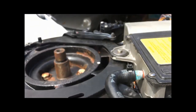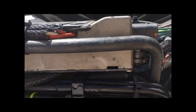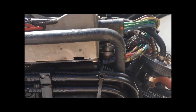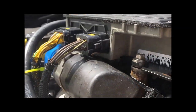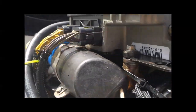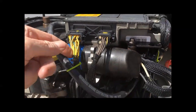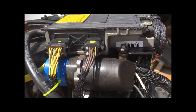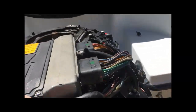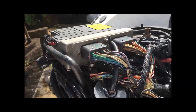I actually removed them, but I think if you remove that forward bolt you can just slide this corner forward. First you have to tilt up the EMM a little bit to get it to clear the mounting on the front, then slide the EMM — this corner forward and this corner to starboard. Once that's clear of the bolt, push this one to starboard and it should just lift off those mounting bolts. It might help if you remove the plugs, but I don't think you have to if you're careful — there's enough give in all the wiring and hoses.